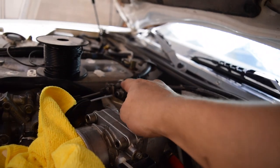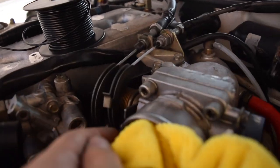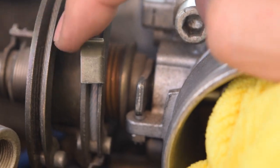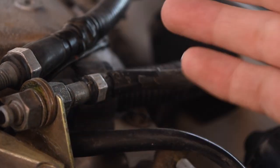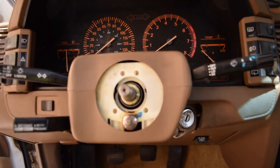When you turn the car on, it's going to idle about 1000 RPMs higher than before. Here at the throttle body, there are two ways to adjust it. There's a little screw at the bottom — this is your throttle, and it rests on a small tab. Mine needed adjustment with some washers to pull it back. Basically, the throttle is open too far because the old automatic system had more drag. With the new clutch and flywheel, there's less drag, so the idle will be higher — probably around 2000 RPMs. Just adjust that idle screw and put on the vacuum cap.